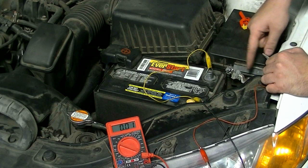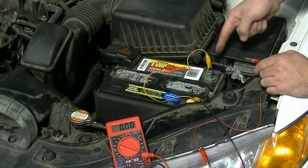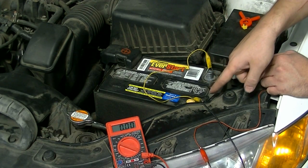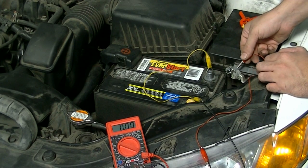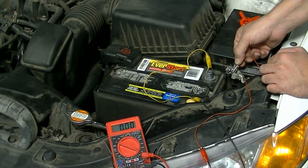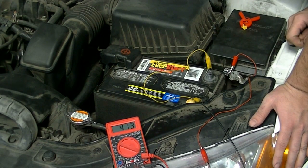What we're going to do next is bridge the gap between our battery terminal and our battery terminal connector using the test leads of our multimeter. I'm going to be using alligator clips, but make sure these are not touching each other or grounded — rest them against the plastic piece of the car if you can. So now we're going to connect this to the battery terminal connector and see if we get any readings. We got about a 4-amp draw on this car right now and this is not good — it's going to definitely drain our battery.